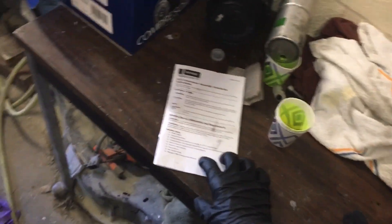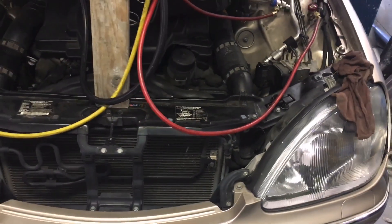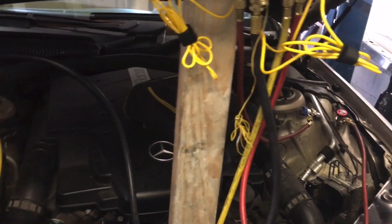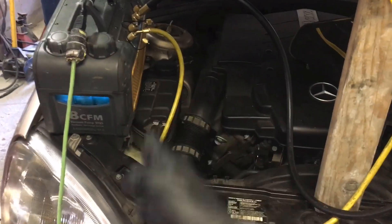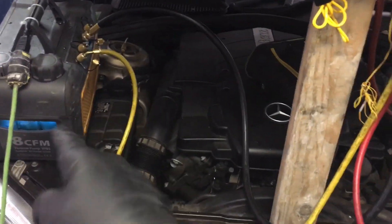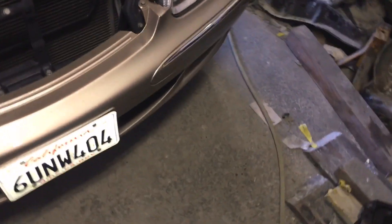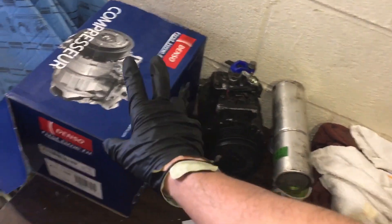On this one — the other video I showed yesterday was from a body shop that burnt out a compressor on another car, but this is the other one. Yesterday I didn't have time to charge it and this car was staying overnight for more service, so I instructed them: leave the vacuum pump on overnight, don't turn it off. So this has been on the vacuum pump all night and we're down to 100 microns, as you can see right here. I'll be turning it off, hooking up my scale and refrigerant, and charging this system up. This compressor came dry — I already put about an ounce of refrigerant oil in.